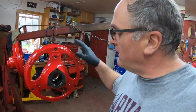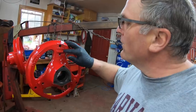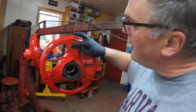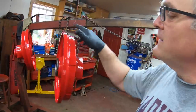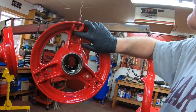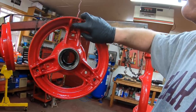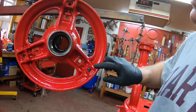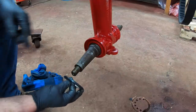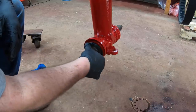Now we can go ahead and put on the wheels, and we had to do quite a bit of work to these wheels — mostly my dad and his machinist friend. These stops were all worn down where the clamps had come loose and worn against things. Dad welded them back up and I ground them down to shape to take that wear out. The biggest job was probably that these had worn down inside the hub, and he built that up with weld, then put it on a mill and milled out a new flat surface for each of the bolts to go on. Hopefully the clamps will fit on tight now and everything will be just like factory. The first thing that goes on is this triple lip rubber dust shield, which replaced the earlier style felt dust shields.